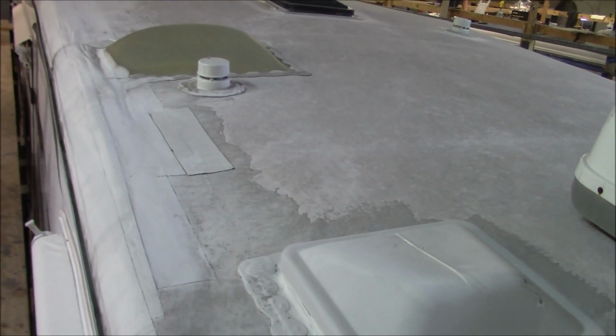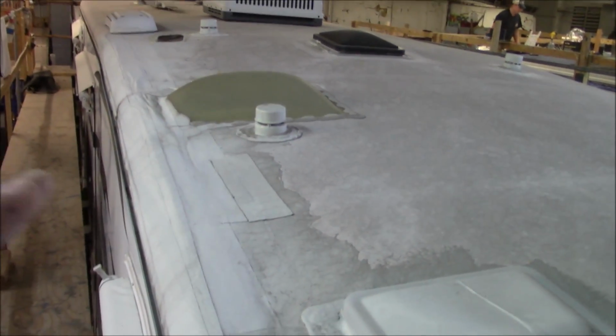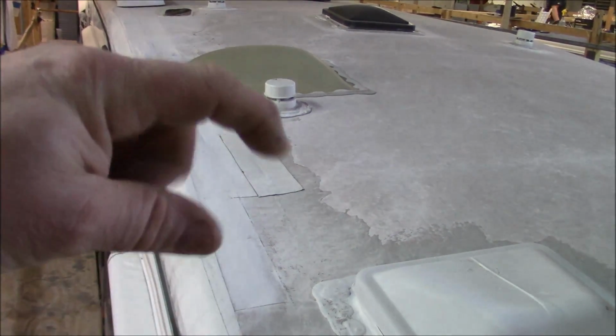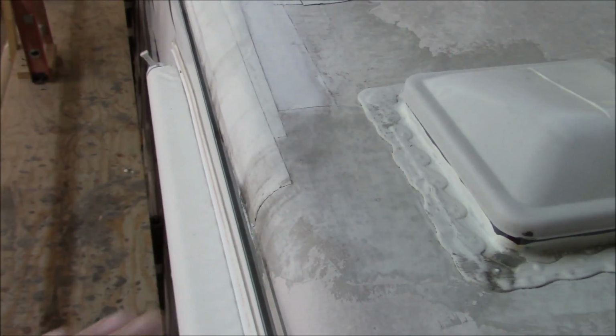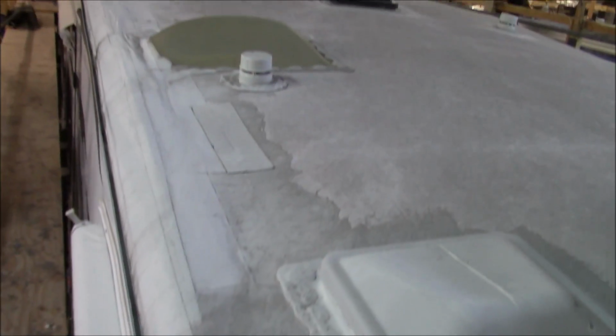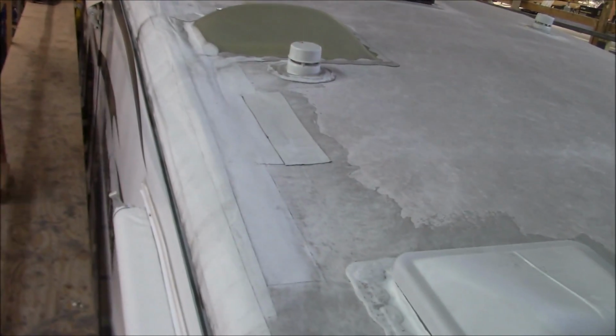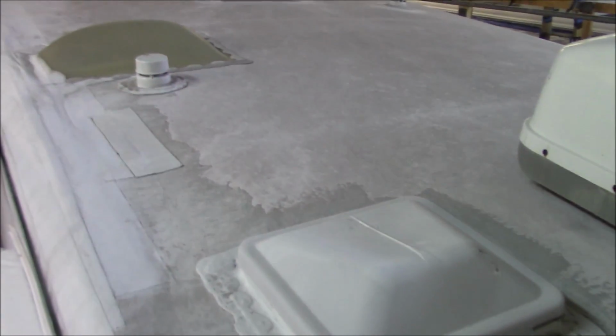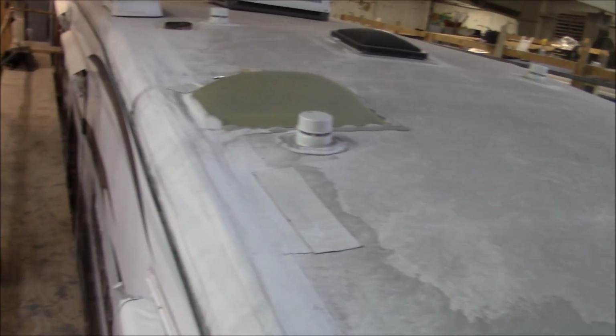On a typical building, you would have to have on the top of the ridge or the roof at the top, you'd have a ridge vent or even a louver. And then at the lower end, like the gutter, you'd have a soffit vent. That's how it pulls. But if you have no other means of draw, you're not going to get any ventilation in there. And there is no other means of draw through here. So it's certainly not going to try to draw all the way up here, not through the insulation, because the insulation is blocking it. It isn't going to happen. But anyhow, that's what we got so far.